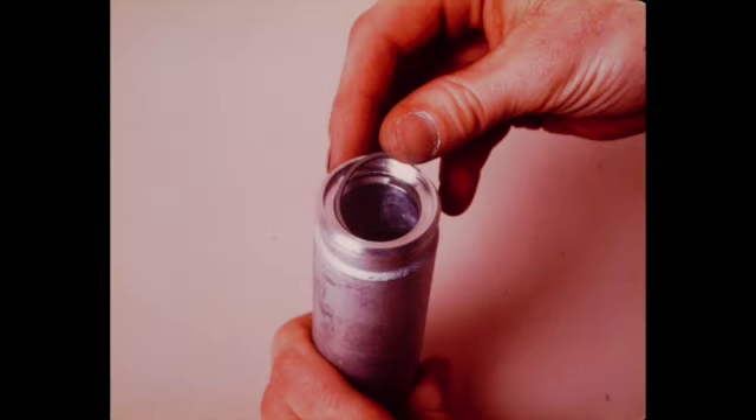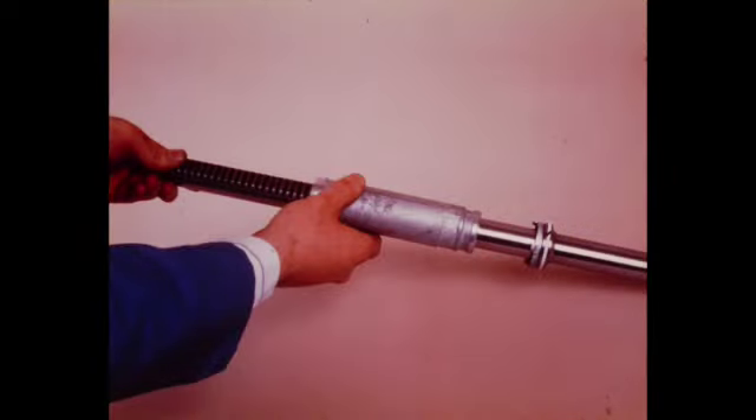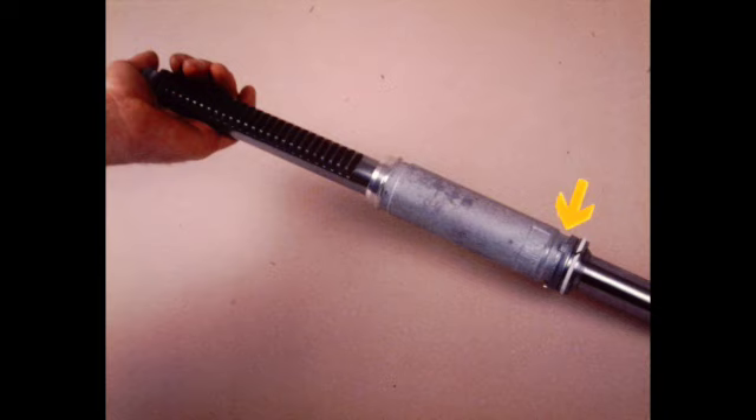Install the inner sleeve O-ring onto the rack bar and seat around the seal. Shape each end of the split bearing and fit to the recess in the inner sleeve, ensuring that it is seated correctly. Position the inner sleeve so that the seam of the split bearing is over the rack teeth and slide onto the rack bar. The split bearing end faces the piston. With the inner sleeve square to the rack piston, push the sleeve against the O-ring, seal, and retainer, and in turn against the piston. Push until the retainer is fully seated on the sleeve. Bend the three retainer tabs into the groove on the sleeve.